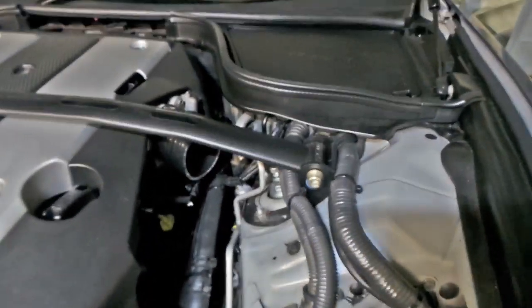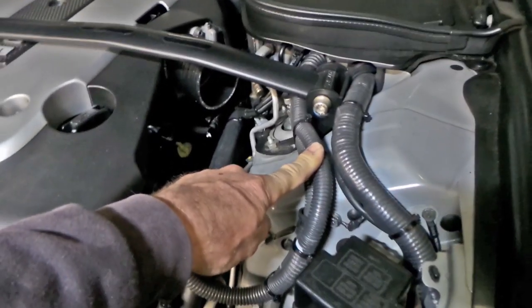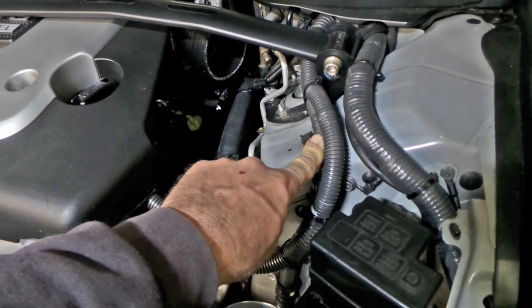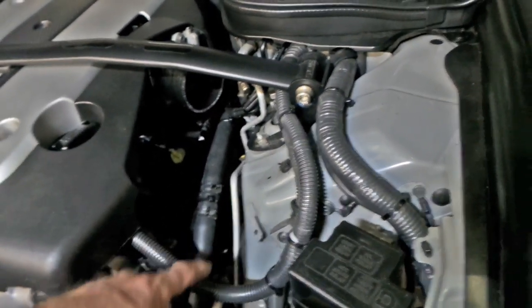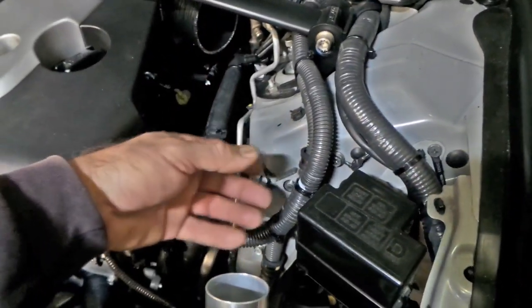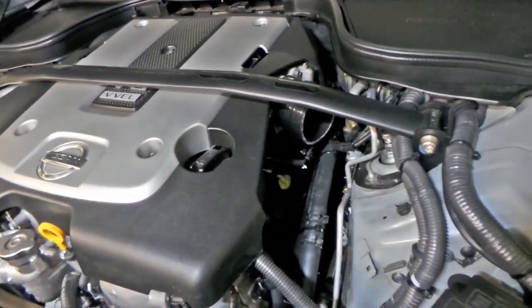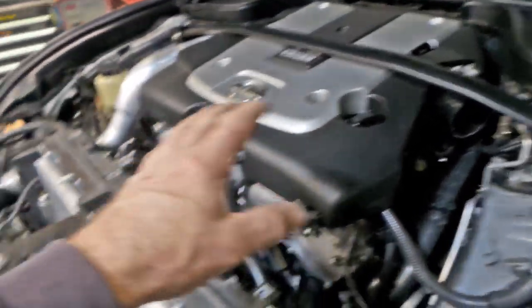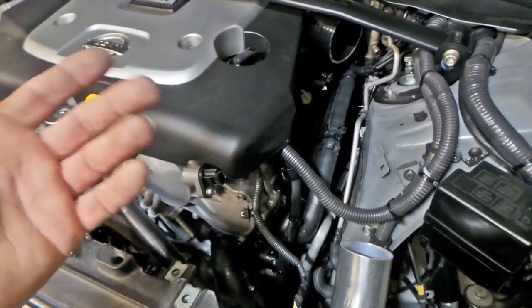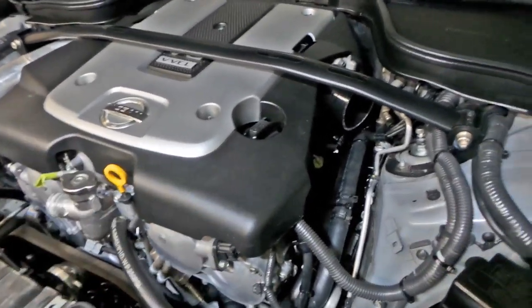As I hit on a bit earlier, I've had to move a lot of the wiring looms for stuff. This is the starter motor positive and the alternator positive wire that recharges the battery. They've had to be moved substantially because of this intake pipe. They interfered. I already actually had to move it once to put this strut bar in. But it's been like that with quite a few of the wiring looms that have had to be repositioned, because they just don't quite work anymore. There's something that they're interfering with, and you just do all this on a priority basis. Things that you can move, you do, and things that you can't move take priority, obviously.